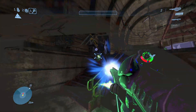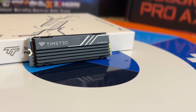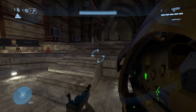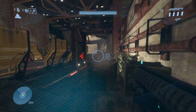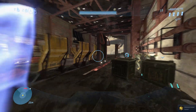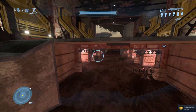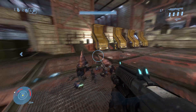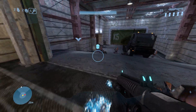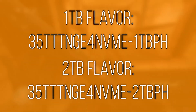I think that the Timetec drive, while it isn't as beefy controller-wise as other more expensive solutions, still performs excellently, which makes it really easy to recommend for the price. The only concern I have is that on the PDF it says at the bottom in grey text: 'Note: we reserve the right to modify product specifications without prior notice.' This is an issue we've been seeing on some SSDs over the past couple of years, where a drive is launched with one set of specs then quietly changed behind the scenes to further optimize cost — usually with a performance hit. So if Timetec ends up changing the specs of this drive after reviews are made, try to be aware of it so you can adjust your purchasing behavior accordingly. I don't think Timetec are going to do this, as I haven't seen them do it on any of their products, but if they do, they'll put the difference somewhere — whether it's a different product number or a variation on an existing SKU.